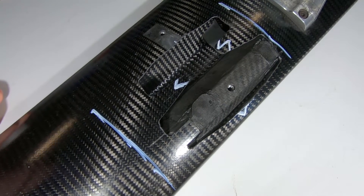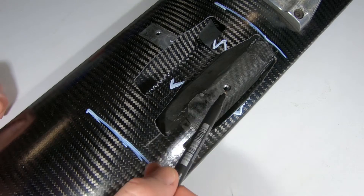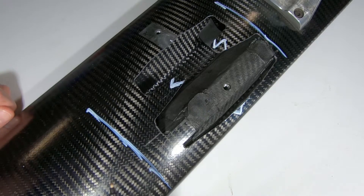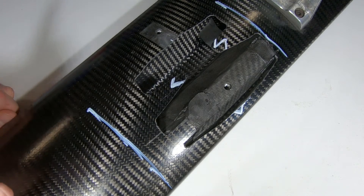Here we are again with the beam wing. It's now got the replacement rib bonded in place. You can see that here — completely covering the hole that leads straight down into the drilled fastener position. I've also cleaned up all the edges around the skin in preparation for making the doubler and then making the replacement skin.